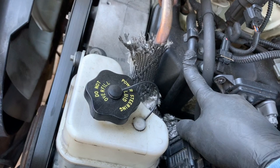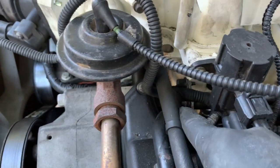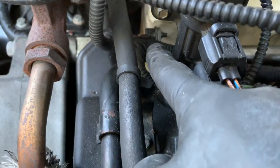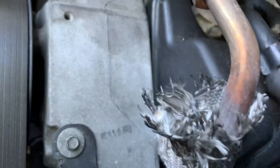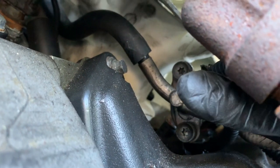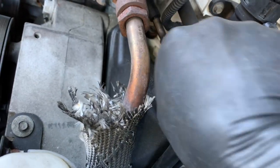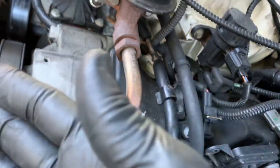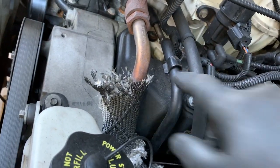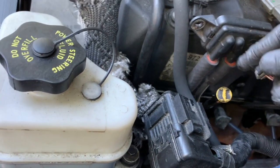The next one is the fuel line — you will definitely need to get this out of the way. The best way: at the back you'll see there are two screws. Take those two screws off and this whole pipeline comes away. There's a joint right there — two screws and it comes away. These are rubber hoses so that gives you flexibility to move it out of the way. This clip is just holding it, so slide underneath that and you'll have enough clearance to get the valve cover out.